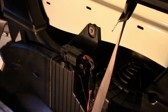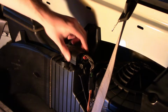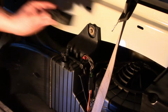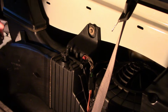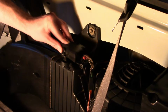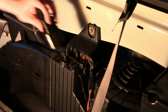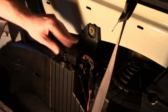3. Alright. Wiggle this guy loose. And again, if you're having any trouble, just use your old pry tool to gently pop that up. That's off. This controls the vent flow, so that's what we're putting it over. Line up the holes in the actuator. This one, you can look inside and they'll show you where the slot fits. This one, they needed it curved. So then we just push it back down.